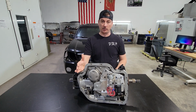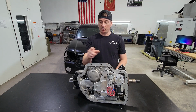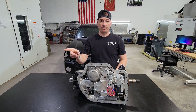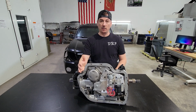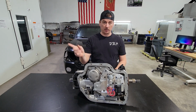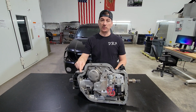If we're utilizing an external dump valve, we're putting a T in. All right, so from that T, we're going to the external dump valve solenoid and then also to the cooler circuit, all right, to the actual cooler itself. When activated, we're creating a hydraulic leak. What that does is, instead of allowing it to go through the entire cooling circuit, we're bypassing that, causing a hydraulic leak to that solenoid.